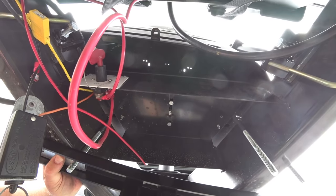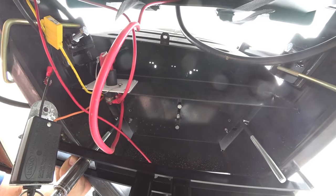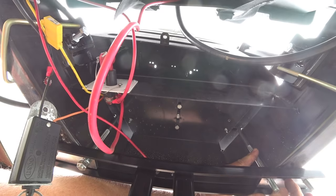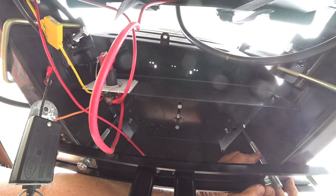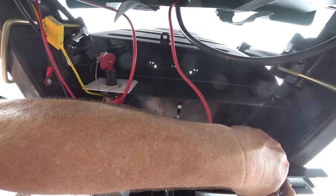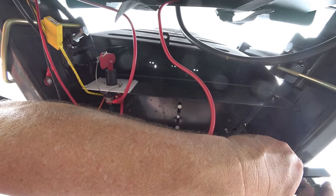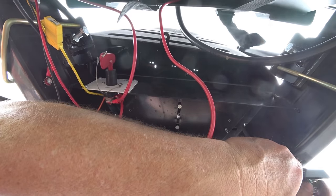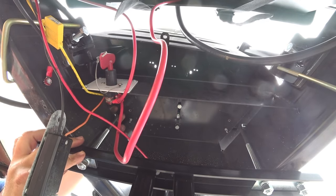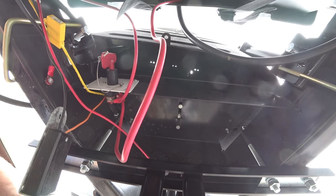Let's get this one started and secured, then go ahead and get the other side of that U-bolt started. The plate goes on, and you can see with this plate there is a lot of left-to-right adjustment available. We'll play around with that whenever we get closer to mounting the yoke, because this is the rear support for the yoke assembly. This is one of the design changes they made to improve on the original Hensley hitch design — it basically takes away those torsion bars that always seemed to have problems. We're right on the 22-inch mark on this side, and we're going to leave these loose until it's time to put the yoke into the rear support.